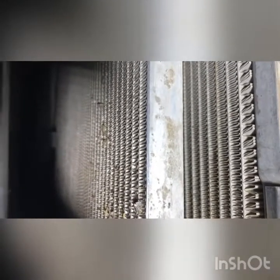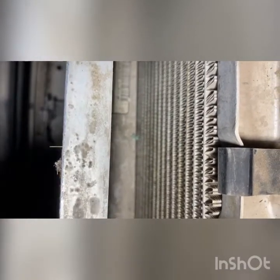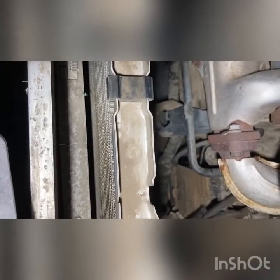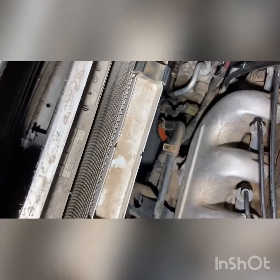Anyhow. All right, well, the next thing I need to do is remove the bolt that attaches the radiator to the air conditioning Freon cooler, the radiator that goes to the air conditioner. You basically have the air conditioning, where it cools down the coolant. And then after that, there's one down there that cools the transmission fluid. And then you got the radiator that cools the coolant to the engine. But I gotta remove the one bolt on that side and one bolt on that side, and then it should slip off the other two radiators.